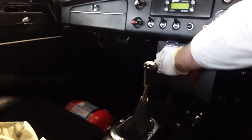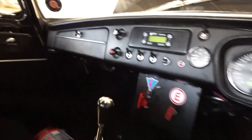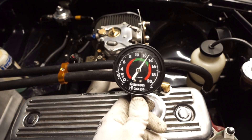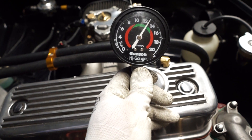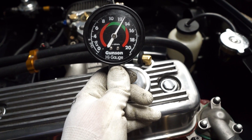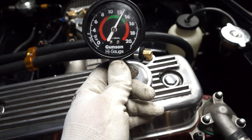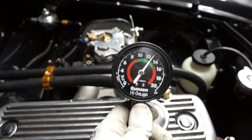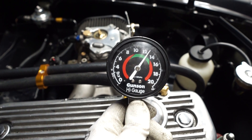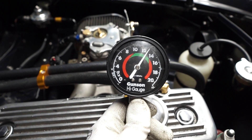Okay so that was ten, so back off again and we'll see what the gauge says. Looking at the compression in the engine bay, it looks like we're just under 200 psi - about 190 from what I can see on the gauge. So I'm going to run this test again and this time have the throttle open just to see if there's a difference.